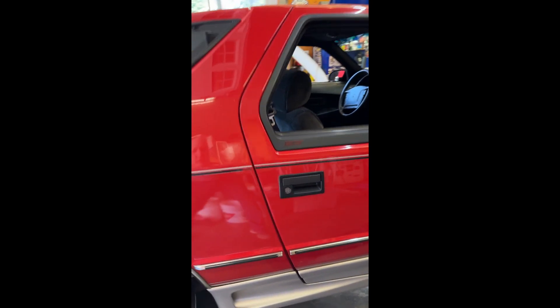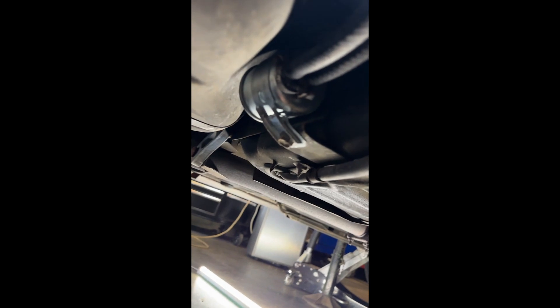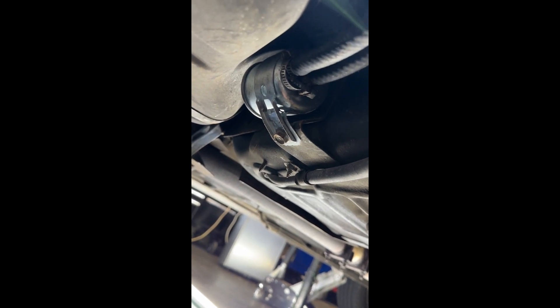Underneath — this is where you're gonna find the fuel filter, right there. First thing we're gonna do is remove that clamp so we can get the fuel filter out and accessible. It looks like a 13mm socket we're gonna need, so we're gonna undo this bolt and make it happen.